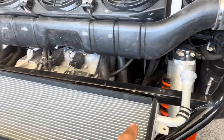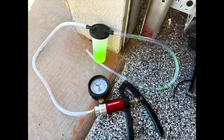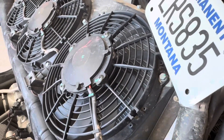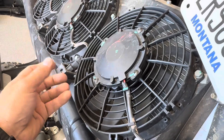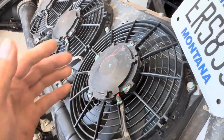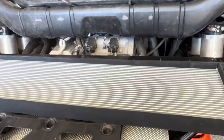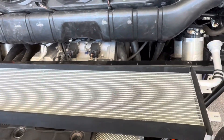It can just get air in the system and need to be burped out. That's what I was originally doing — I had a vacuum pump on it and we were trying to pull the air out. But as we were standing here pulling vacuum, I could hear bubbling; I could hear air bubbles coming in through the liquid in the heat exchanger on the other side. Sharing that so you understand how this system works — if you've got a problem with it, you can diagnose it better. Hope this helps.